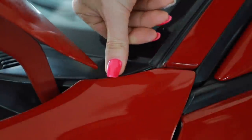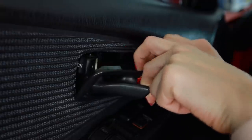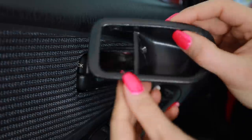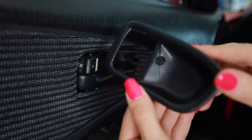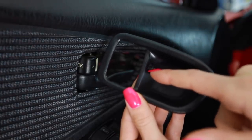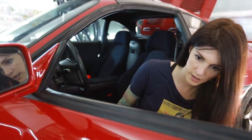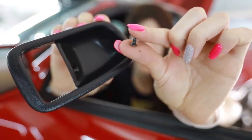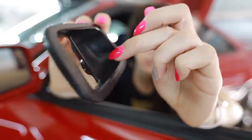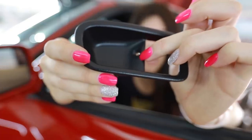Got the cracked hardware out of there. Got these little plastic caps where they're supposed to be. Now I go ahead to rip out the door pockets here that are cracked. These are common to break on the MR2 and it's usually from using the wrong hardware in here. The correct screws that are supposed to go in here are beveled so that way they seat inside this little bevel inside the plastic.